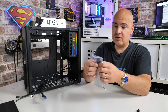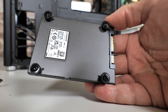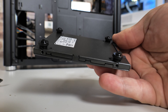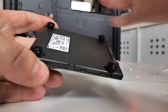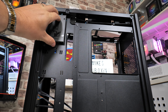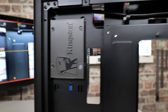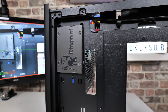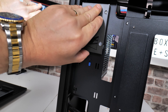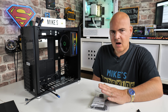The accessories bag is actually quite nice — you get velcro strips for cable management, cable ties, a bunch of screws and fixtures, spare rubber drive mounts, and a little bit that fits on your screwdriver for installing motherboard standoffs. One important note: when I first opened this case, the standoffs were in a hybrid position between ATX and Micro-ATX, so do check those carefully before final mounting. It's clearly laid out and there is a manual included.